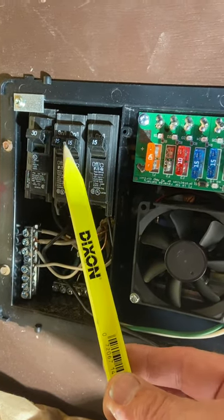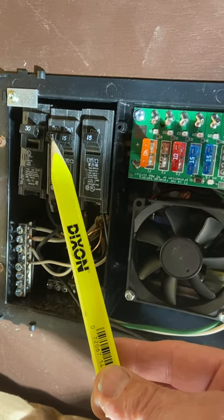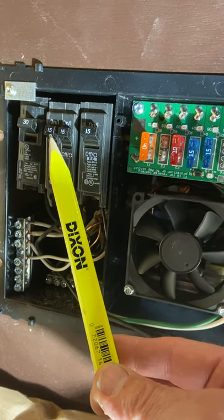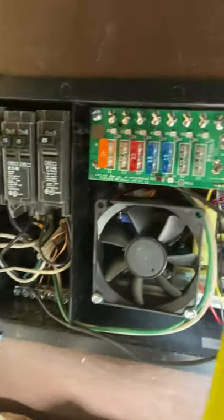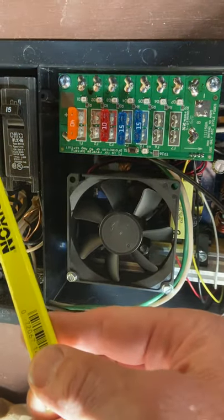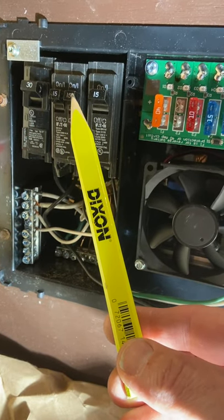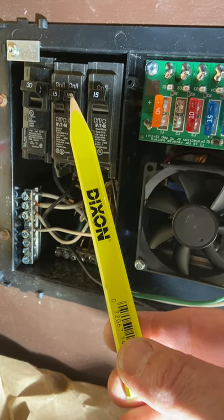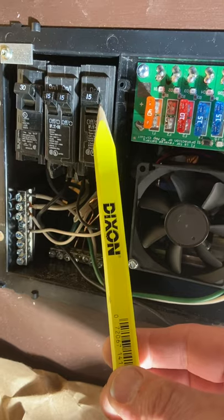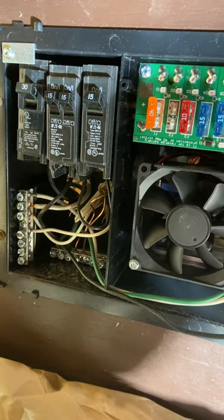The next one — I put in a split breaker, so two 15 amp breakers. One of these breakers has to be dedicated to the converter, so it has to be a 15 amp breaker for the converter. That's this singular black wire coming out here going into that 15 amp breaker. I have a 15 amp breaker set up for two outlets right now. I have a single 15 amp breaker here — I could put in a split one but I've left it since I don't have too many things to power up in here.